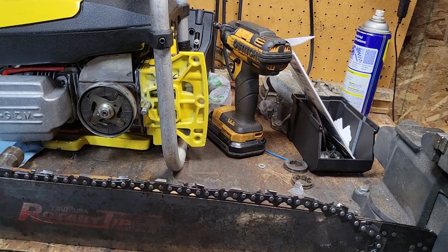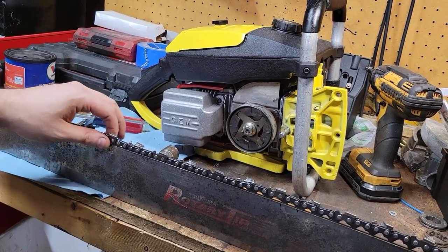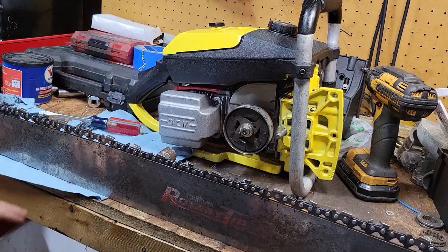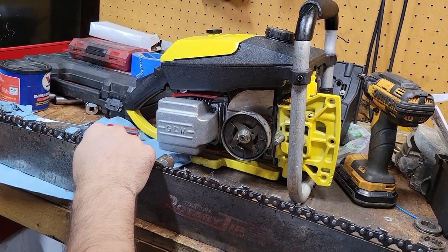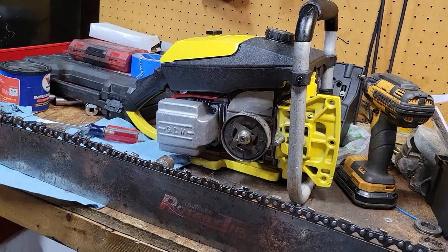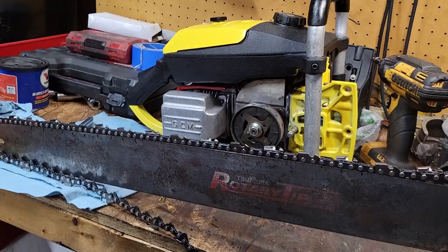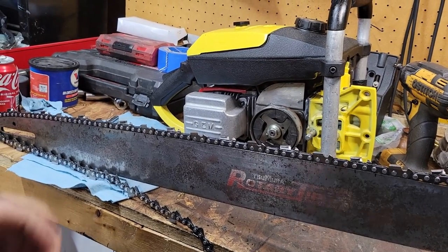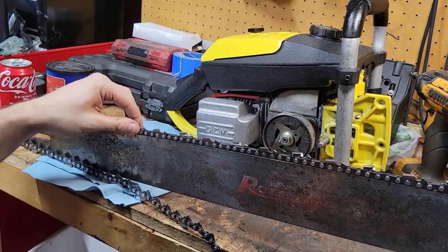Yeah, fits good here. See where I'm talking about there? Where I've marked it. So it's tight. A little too tight. So we'll open it up. I'll just go through and tap them through. Much better. All the marks in and out, and it's not excessive in any way, shape, or form.